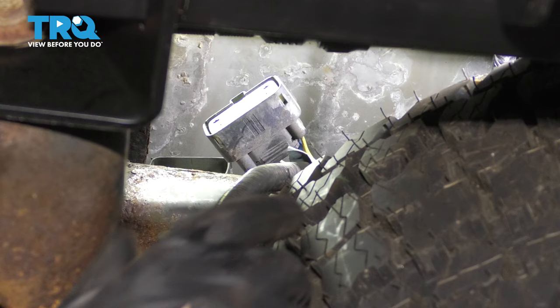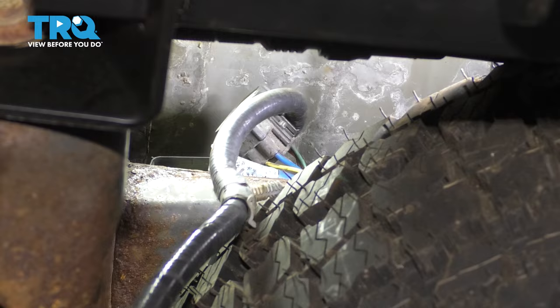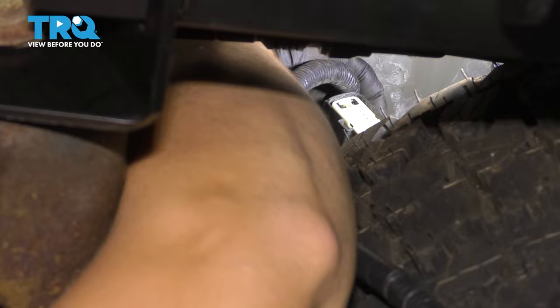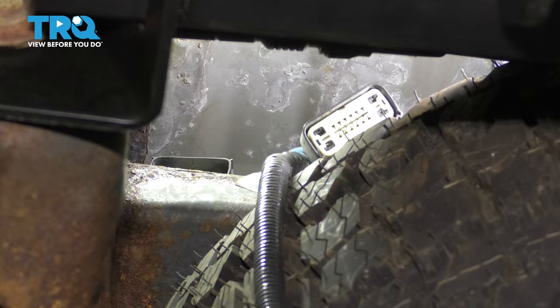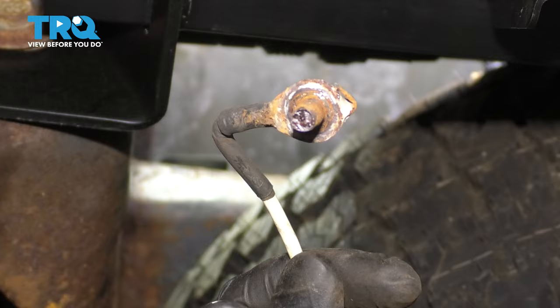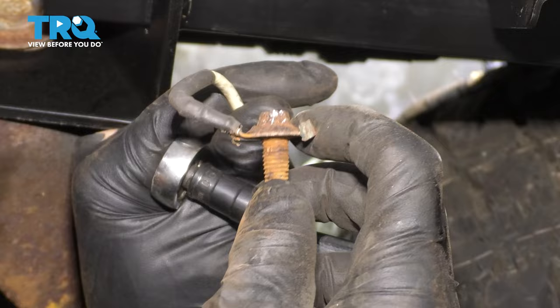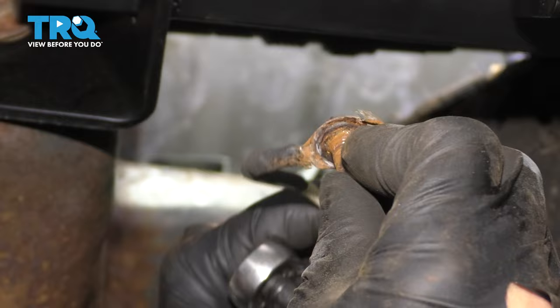10-millimeter bolt at the top, like I said. As I'm unthreading this, it's actually twisting the harness up there, but that's okay because it's unthreading — that's what matters. What's happening is the eyelet that the bolt goes through is seized onto the bolt. You could either cut the wire at this point or just unloop it every time it does a loop. You can see the bolt is completely seized to that eyelet that secures the wiring harness, and that's why it was not coming off properly.